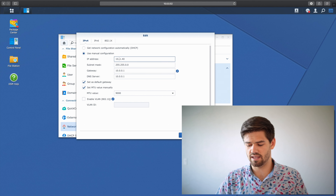Now that that's done, all we need to do is set up our computer to be on the same subnet on that port, and we need to set it a static IP address. This is going to work the same between Windows, Mac, and Linux - it's just going to have a little different ways of doing it. On a Mac, go into Network Settings, go into whatever Ethernet interface it is, and set it up manually. Put it on the same subnet - that was 10.10.10 - and set the address to 10.10.10.10. This way we're on the same subnet but not trying to get the same IP address as the Synology's 10 gigabit port. For subnet mask, match it with 255.255.255.0, and no router needed - just hit Apply.